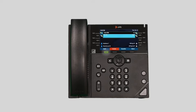You can use the additional soft key options to manage the conference call. Press the hold soft key to put the conference on hold. Press the split soft key to split the calls from the conference and place both callers on separate holds. Press the park soft key to park the conference on a virtual extension. You can end the conference by pressing the end call soft key.